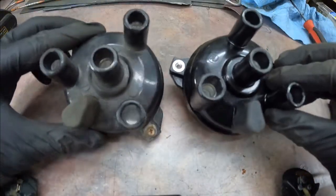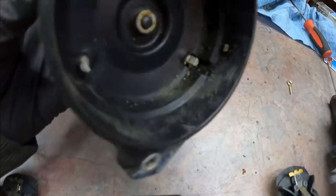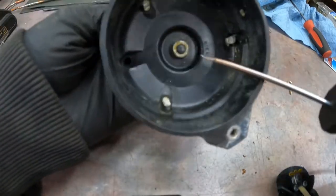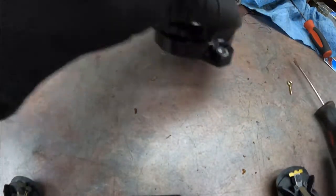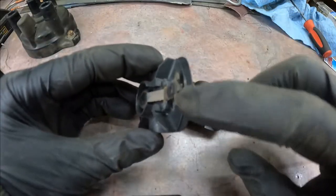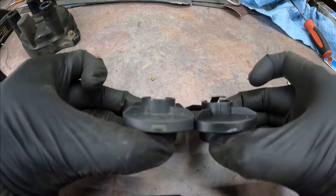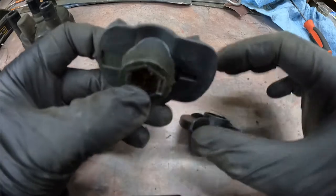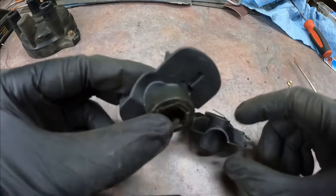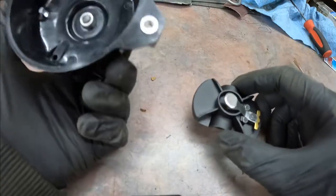Here's the new cap and the old cap. The old one had the broken bolts that had to be dealt with. Inside, all of this crap is actually coming off the pickups, so it was in pretty rough shape. Looking at the rotor, you'll see the same thing — the new rotor is going on but the old one really wasn't making much contact. The main pickup spring is pretty worn out, and it's actually cracked right here. So I'm going to put these new ones onto the dizzy and get it back in the truck. Hopefully that's all the problem was, otherwise we'll be doing a little more diag.